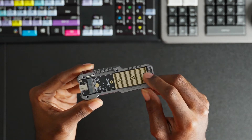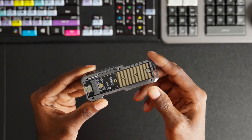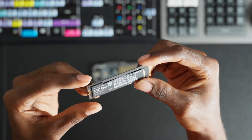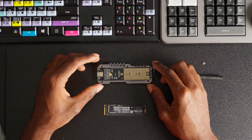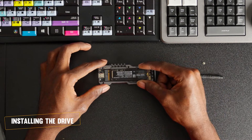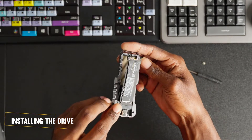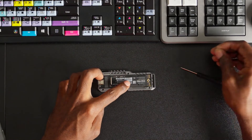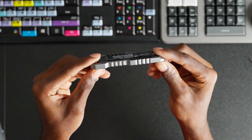The next step is to take this screw out at the back side so we can slot our M.2 drive in and then close it down using that screw. This is our Samsung SSD — it's a terabyte, so we're going to have a lot of external storage to work with. Once you get the screw out, place the drive by sliding it into the PCB. It should stick up at an angle — that's fine. Push it down in the back and replace the screw. If it's in all the way, no drive should be sticking out and it should be completely flat.